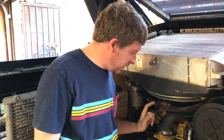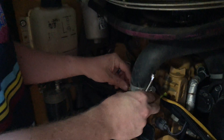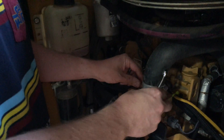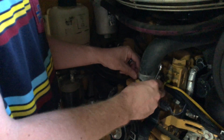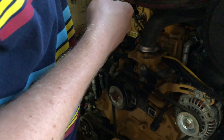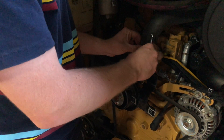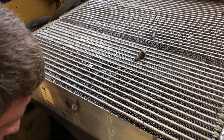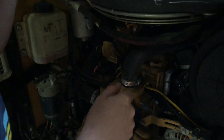The coolant is drained. Now I'm going to try to get to the regulator. There are three bolts up here — they're 12 millimeters — and I've already cracked them with the wrench. I'm going to try to leave the coolant hose on; hopefully there's enough flex in it where I can just leave that attached and not have to worry about taking the clamp off. I always like to place my bolts so I'll remember the orientation and put the same bolt back in the same hole.